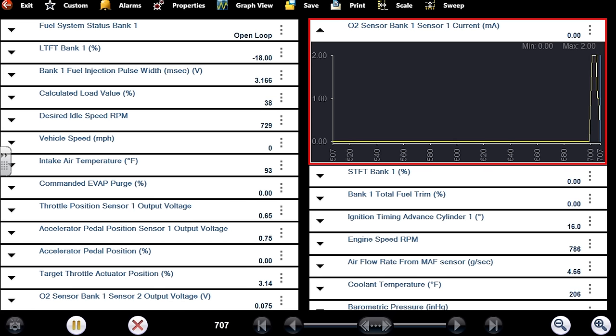Danner cleaned it. Sometimes airflow in front of a MAF can be a factor so we'll have to inspect this housing closer. I don't think that cleaning is going to make a difference from what I've seen on that style. It's almost like there's a blue and white painted resistor — they don't have the same contamination problems.